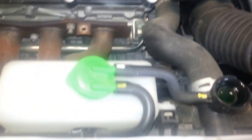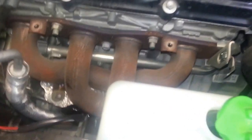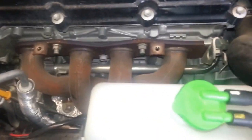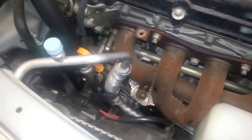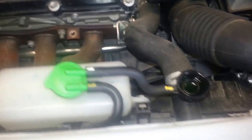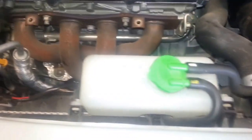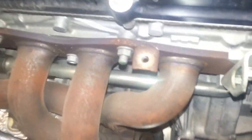Okay, thanks. Okay, next on the bucket list is the coolant, and I'll take you down where the drain plug is for the radiator. Now I'm actually going to be removing the block heater in order to get as much coolant out as possible. In the Suzuki service manual, it says run the engine up to operating temperature with the rad cap off, and then drain the coolant, as obviously the thermostat is down there, opens up, and then keep doing that and filling it up, running it up with the cap off to operating temperature until the fans come on and the thermostat opens, then drain it again. And I'm going to do it an alternative way here, which is a little bit more difficult.